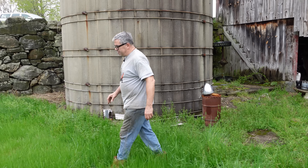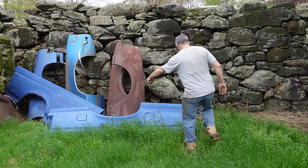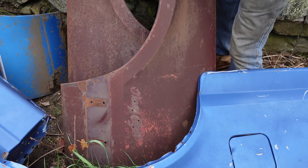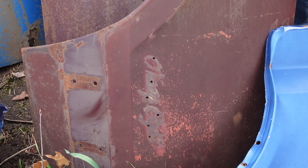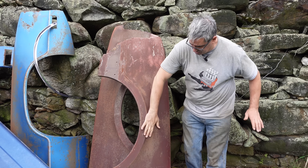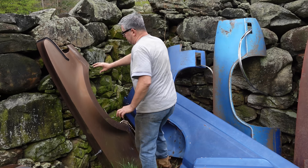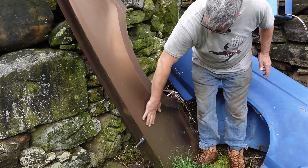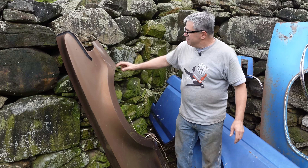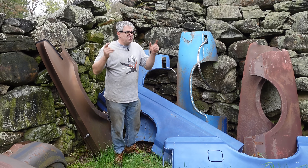This gives us a nice opportunity to look at family styling in various vehicles — in this case, Oldsmobile. This fender right here is an Olds 98, the top-of-the-line rear-wheel drive, big car, generally four doors. Notice the very firm wheel arch and the rounded shape. That family styling was also used on the Toronado fender — very similar bold arch, but much more crown. The Toronado was front-wheel drive, had a wider front track, and a more slimmed-off tumblehome. So the family styling from 98 to Toronado kept people understanding: that's an Olds coming down the road.